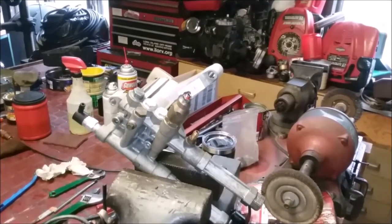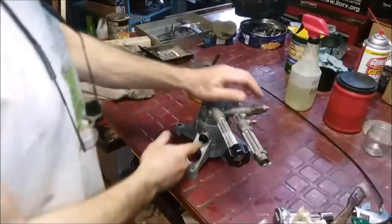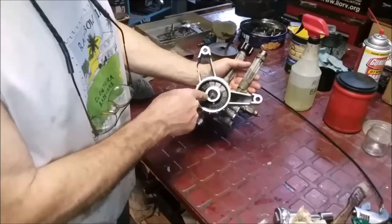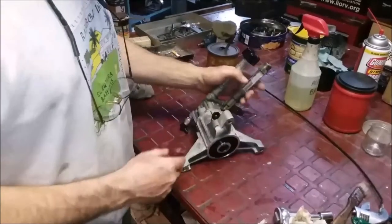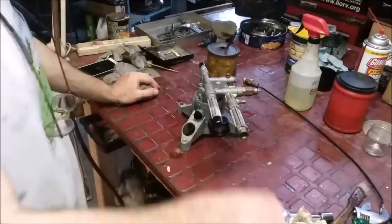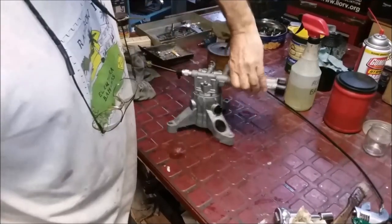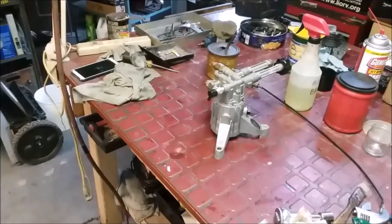And we're going to do a little motor swap, chassis swap. All right, as it sits right now, it's ready to go. Now, you could check this, but there's no water or anything I see going on. Put a smear, clean everything off and put a smear of regular, you know, bearing grease there. And a little bit of bearing grease around these threads and in there that we had previously cleaned. I showed you what I was doing with that. Yeah. So, everything else seems to be ready to go. We're going to put this on the other chassis now. And we'll retest if it's not pouring on me.